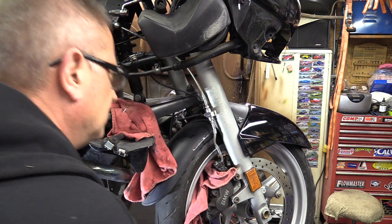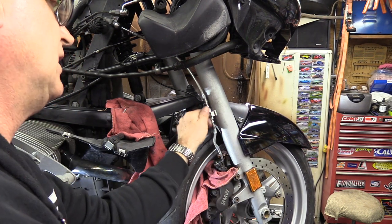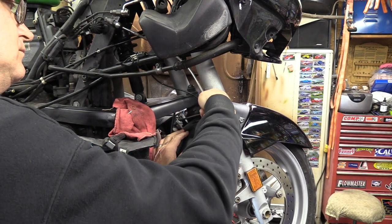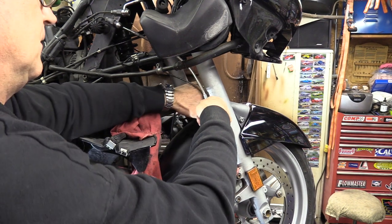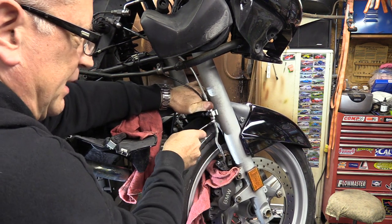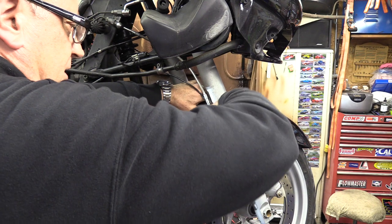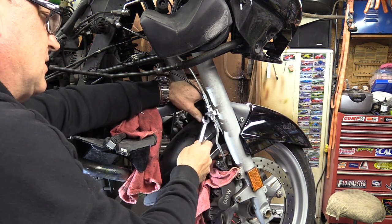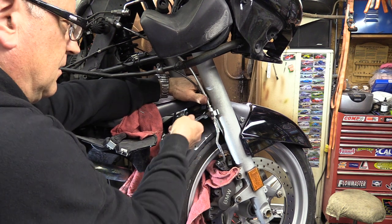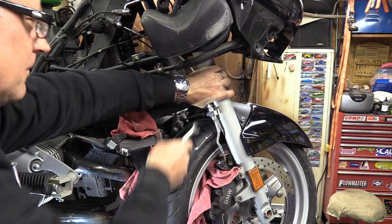The lines orient to a little stop that's on the caliper — just make sure the line is behind the little stop so when you tighten it down it goes against the stop. Take that 11 millimeter fitting and thread that in. This can be kind of tough to put back on there sometimes. These three connections are pretty much on there at this point, so I'm going to go ahead and tighten those down. Tighten until they get a pretty good bite — you'll check everything after and tighten up any leaks.